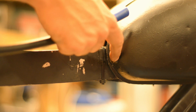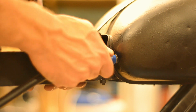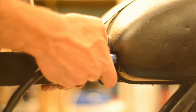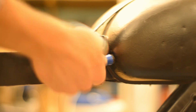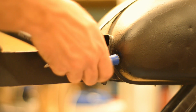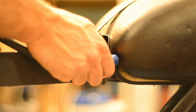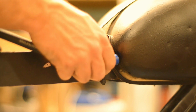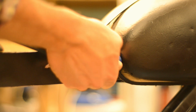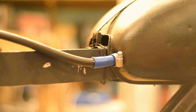I haven't got anything M12 by 1 millimeter. So a little dirty fix here. I will order a fuel valve or a nipple to replace this with, but just as a temporary solution. This may or may not leak badly. Perfect for a death trap.